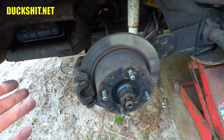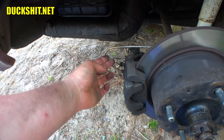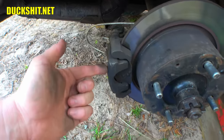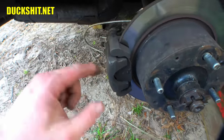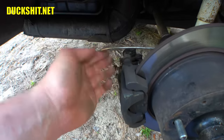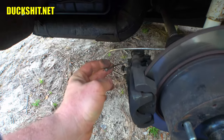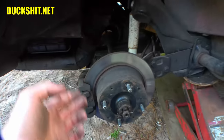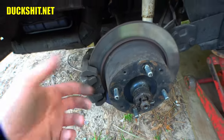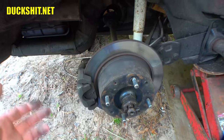It seems like everybody makes the same kit anymore. But what we're looking at here is the e-brake cable. This lever is what actuates the brake pads on here, and this thing has a lot of brake dust on it. When the cable snapped, this thing snapped open and you saw how far it ejected the cable — it threw it way out there. With disc brakes, I don't have to take a drum apart, I don't have to get up inside of it, I don't have to pull a retainer clip off the back side, I don't have to do any adjustment nonsense on the back side, because it doesn't have any of that.